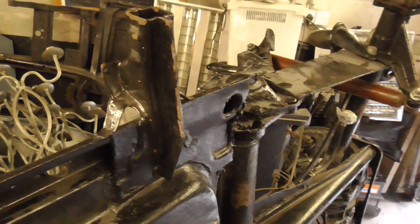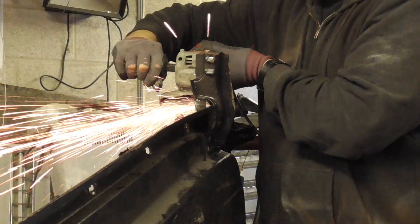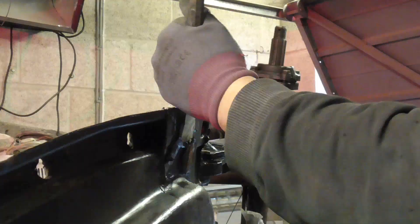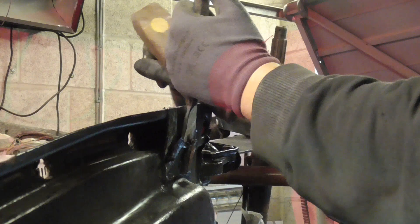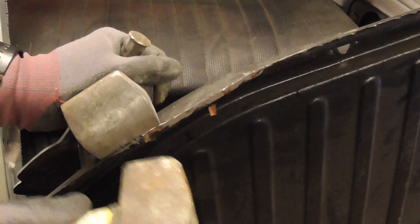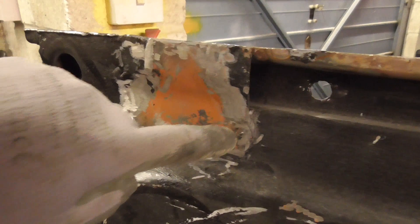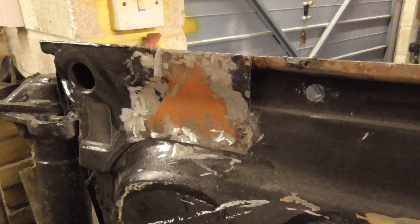It is a bit of a rust trap, a bit of a water trap. I guess all I can do is fill it with wax oil and as much under-seal as possible to try and keep it rust-free in there. That's both the jacking points removed. Looks a bit scrappy at the minute but I think it's a lot better — a lot cleaner lines, nothing stuck up nasty. You can see where the jacking points are a rust trap though; that's just kind of primed painted steel, and over time water gets in there, it flakes off and you get rust building up inside the jacking point areas.